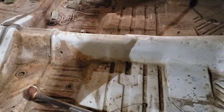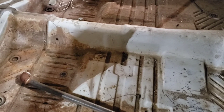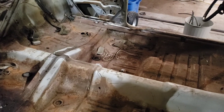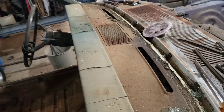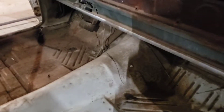Then I need to go through and knock off all of the loose rust off of the floor and the trunk, treat it, and get that primed and painted. It's going to be white, just like the rest of the car. I'd probably even paint the inner quarter structures and related things. Moving on to the interior — now that the dash is out, I can drop the steering column and the dash, and then prep and clean the whole firewall area, which looks nice and clean overall, though there's probably a little bit of work to do there.